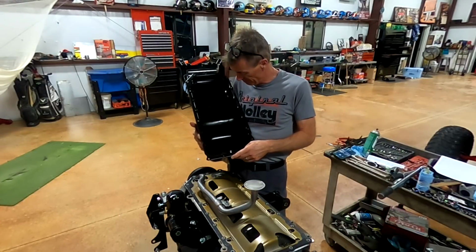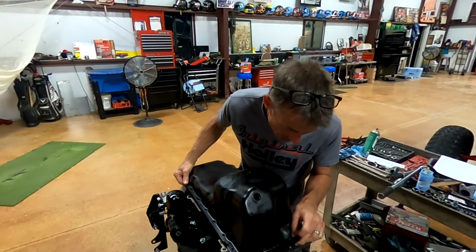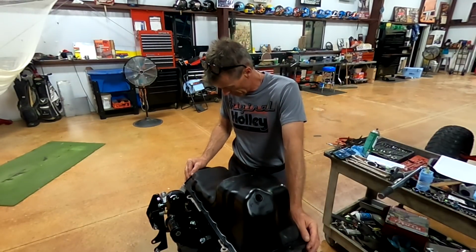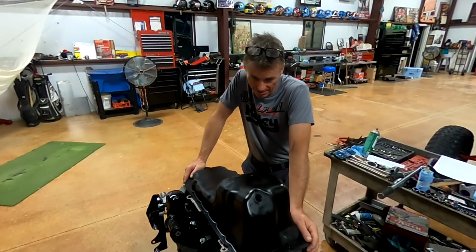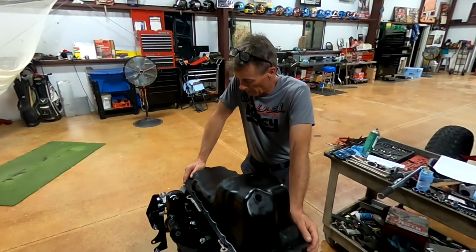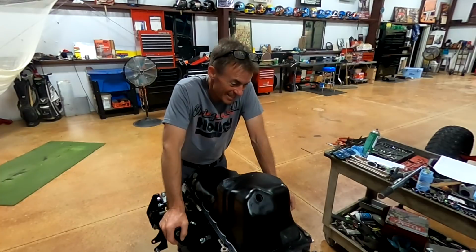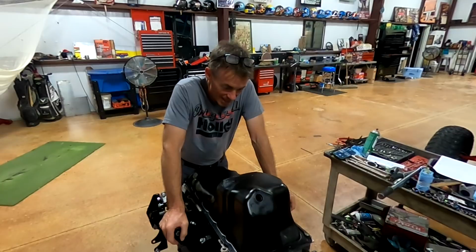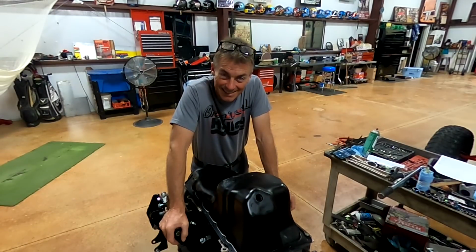I think I better do that because while yes, my whole goal in this truck is going and spinning tires and stomping on the loud pedal and swapping gears, I will be plowing on the brakes from time to time too. And we're waiting on other parts to come in. So I think that's probably the smartest thing for me to do, because while I know I'm gonna hurt this thing, why should I hurt it on something that I know is going to be a problem, where I could just take a little piece of thin sheet metal and weld it in there, basically make a place for the oil to catch when you pile the brakes on. And that's probably a good idea. So I think I'll do that.